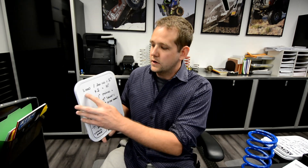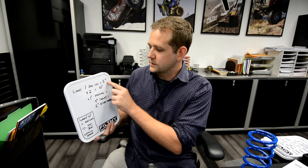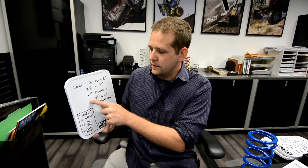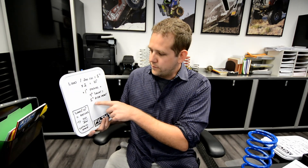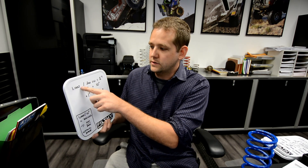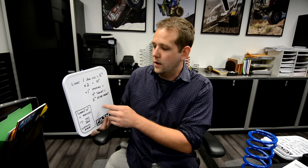Once you come up with this number, do a double check to make sure you're right, and it also gives you a chance to move one number up or down to get more separation. With a thousand pounds of weight and a 200 pound spring, that spring is going to compress five inches. With two of those springs, you'll squat down 10 inches, which is what we were hoping for. Add an inch of preload and you end up with nine inches of squat — that's your five inch ride height. The numbers work out great. You can change the corner weight if you think it might be heavier, or change your springs to a 250 or 300 to see how things work out. The double check also works as your trial and error when you play around with it.